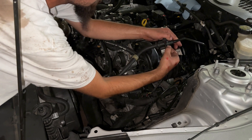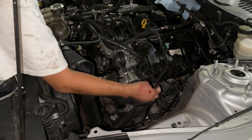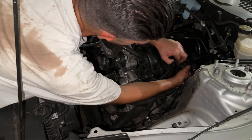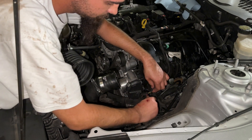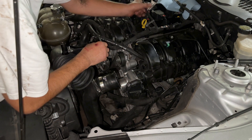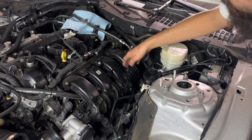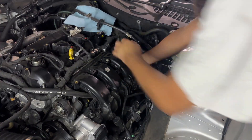Once it pulls itself out, you're going to turn the solenoid to get more of it out and pull it off. Now we have two more harnesses — one connected to your throttle body and one connected to your mass air flow sensor. Press the button on top; this one has a red tab, so pull that red tab up, push down in the center, and that harness comes right off. There's another hose connected to the back of your intake runner that's connected to your boost — there are two black tabs on top, push them in and pull it off.